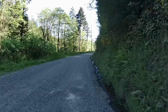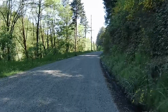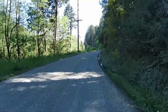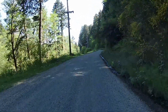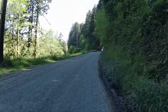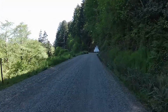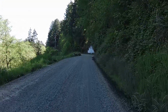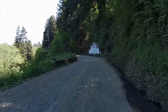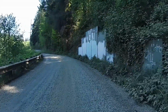You know, in that case, rubbing alcohol, ooh, big pothole. Rubbing alcohol on your rotors, clean them really good, and then I take some really fine grit sandpaper and go over the rotors, inside and out, really carefully. That generally stops any weird noise that I have off my brakes. They actually stop squeaking on your brakes as well.